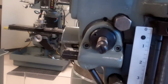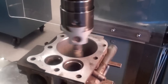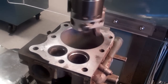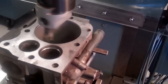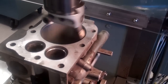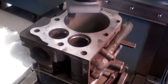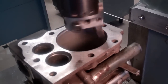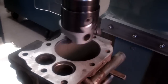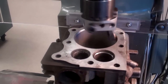I've got the machine running with the automatic quill feed engaged at the slowest downward speed, and I've got the boring head where it's just slightly ticking. This is just going to be a light cut. It sounds like it's cutting very evenly around. Once it gets past that ridge it's going to stop cutting, so I'm going to back it out and open it up a little bit. There's more wear on the side of the cylinder closer to the valves than on the top. It's stopped cutting so I'm going to shut her down and change my setting.